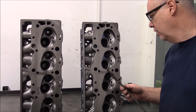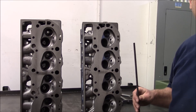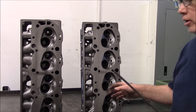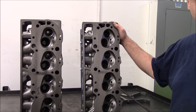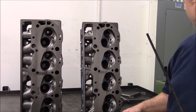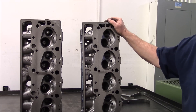When building an engine like this, you always start with the cylinder heads. You build your heads first — get them flowing the way you want, get your chamber volume set, and your heads are done, ready to bolt on the motor. Then you build the rest of the motor around the heads. I've built this motor several times, so I know what I'm looking for on the head and what I'm going to get when I finish.